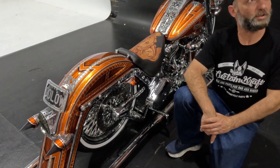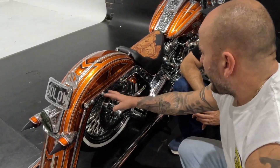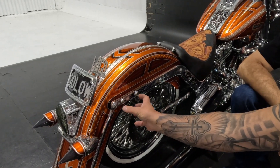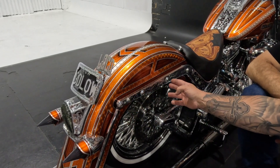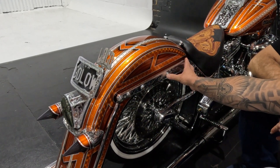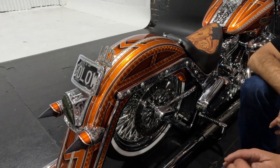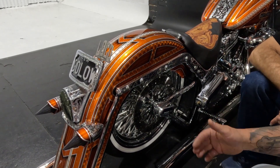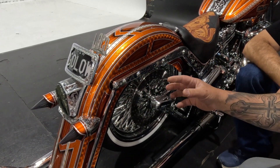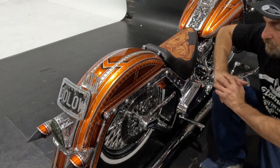On my bike I've actually extended my inner fender strut all the way to the very end — you can see where it's solid just in here. I didn't want to mount my bumperette on a nut and bolt, and the other idea of it going all the way over there is that because it's got a nine inch stretch it minimizes how much flex and shaking the guard does while you're riding. It still shakes — you can't control that — but you're minimizing it. It's a Harley brother. It also minimizes cracking.